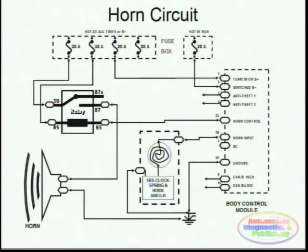The computer actually controls the coil side of the relay itself. And by controlling the coil side, the relay — and this is a mechanical relay — is activated, and the horn will make a sound. Again, this is not a high-speed control, since the actual body module is interested in simply turning the horn on and off, and that is sufficient for this type of operation.